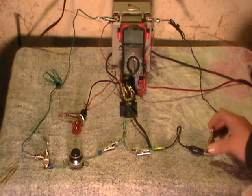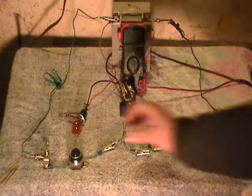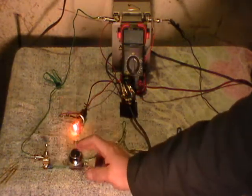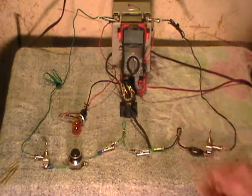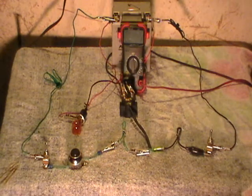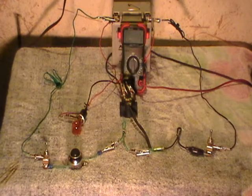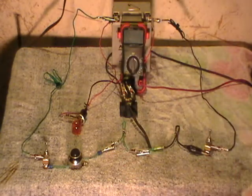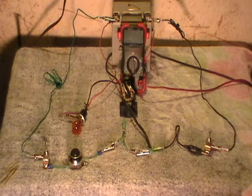When you go to start up your MADASS, you turn on the ignition key switch, pull in the clutch, and if everything is working correctly, you push the starter button and the bike cranks over. But imagine if you did all that — turned the key, pulled in the clutch, pushed the button — and nothing happened. The first thing that comes to mind is a faulty starter, and that's a logical conclusion. But what if you spent fifty to seventy-five dollars, waited a couple weeks for delivery, spent an hour installing a new starter, and got the same results? You probably have an electrical issue — somewhere in a switch or in the wires.